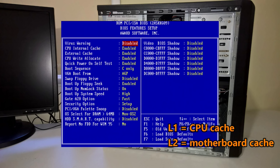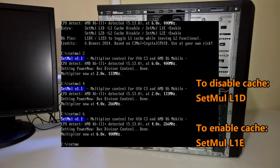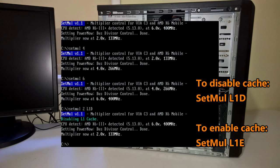You need to look for the options L1 cache, which is the CPU cache, and L2 cache, which refers to the motherboard cache. The CPU cache can also be configured through software. The tool I'm using is called SetMul, and I will put a link in the description of where you can download it. So the CPU cache can be changed in software while you're running Windows or DOS, but the motherboard cache can only be changed in the BIOS.